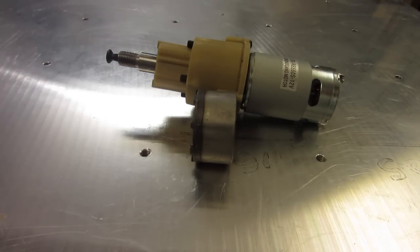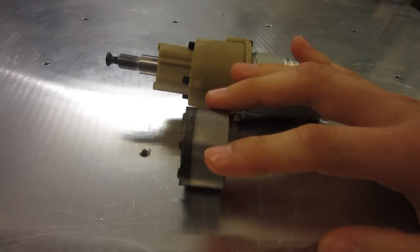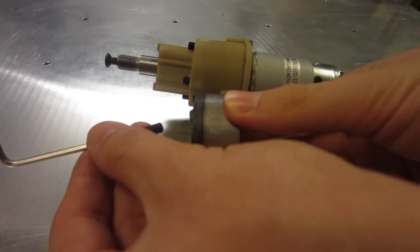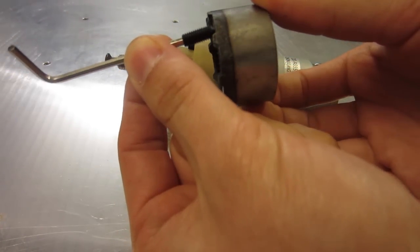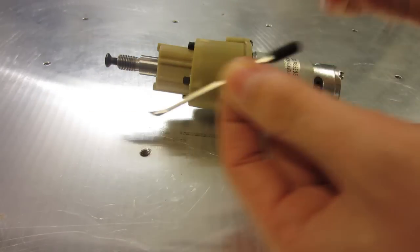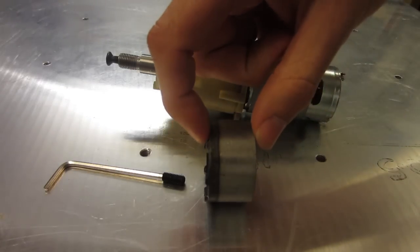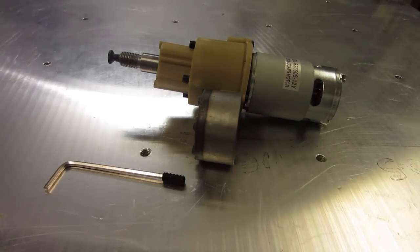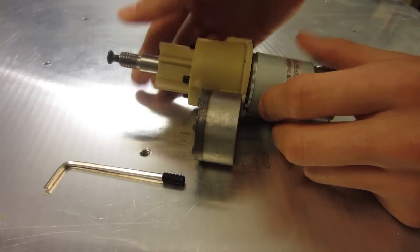This is how you set your grub screws into your gear motor. Here's a fully modified gear motor, and here's a ring gear from a drill gearbox. You can see in the gearbox where it sits — what you do with your grub screw is sit it between those ridges, and it stops the ring gear from spinning and lets the motor transfer torque to the output shaft. When tapping these grub screws, you want to tap them just enough to get in between those ridges but not push too much, otherwise you'll put pressure on the gearbox and lock the whole thing up. It's a bit of a fine art — as you're tightening them up, give the gear motor output shaft a little turn to make sure you're not locking it up too much.